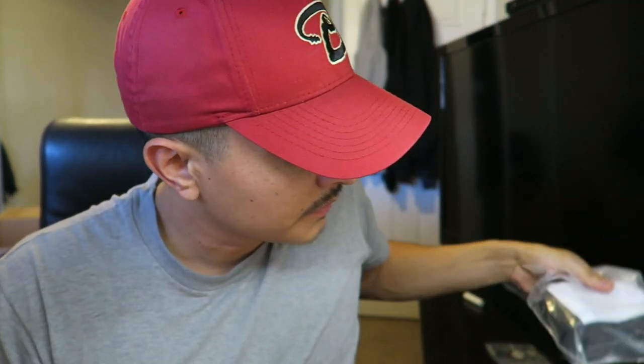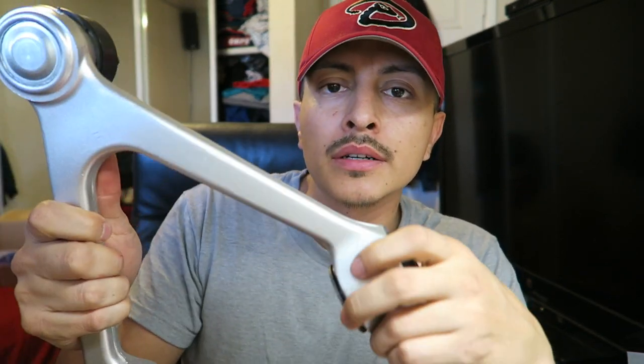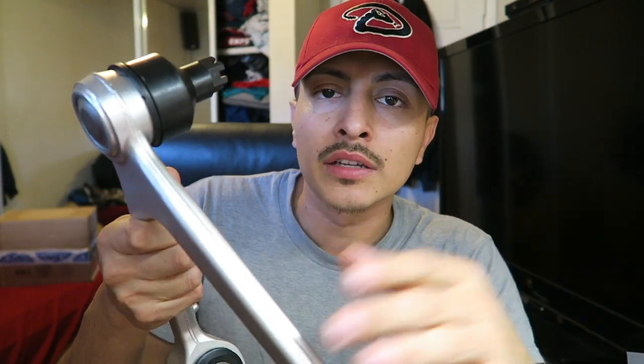First, let me show you some of the parts I've bought so far. These right here are the lower control arm bushings. I'm gonna go to the machine shop and get the old ones pressed out and install these new ones — that's pretty much it for the lower control arms. I'm also going with OEM upper control arms; these are Dorman. I bought the whole arm instead of just changing out the bushings because they're fairly affordable and good quality, and I'm changing both sides out.